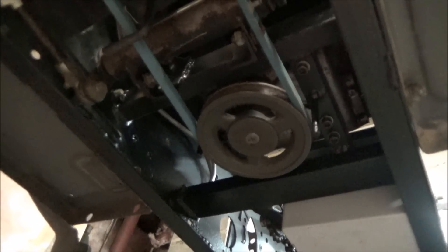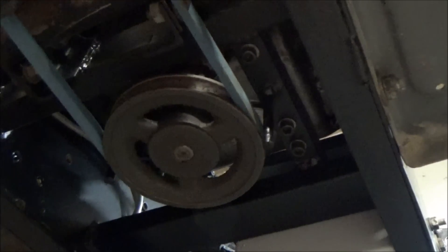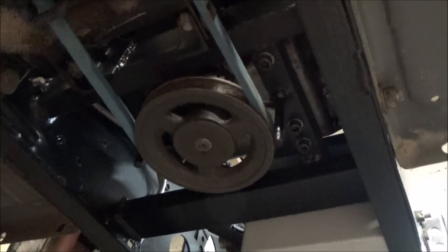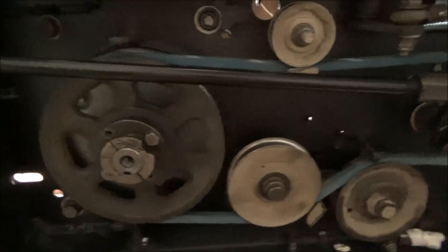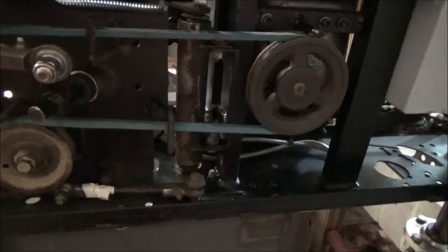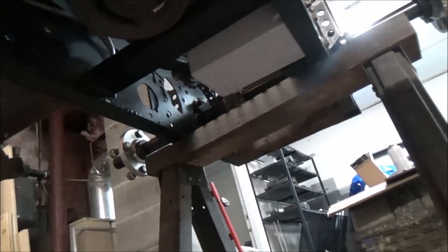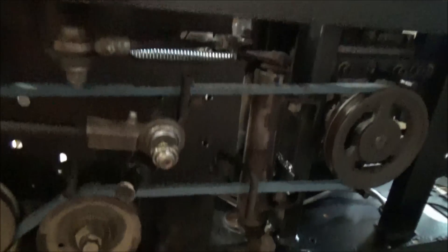Underneath the transmission now, and you can see the rear pulley. That's the transmission up there — it's a little grimy but you can see that aluminum. It's bolted into just a little bracket I made up. There's the battery down there for reference. You'll see it's not all that much different from a regular stock lawnmower — it's still a belt drive. That's in the rules. I race USLMRA, and I believe it's in most rules to have some kind of belt clutch where you actually have to disengage the belt, except for some of the more exotic race classes. The steering arm down here — this is all custom-made stuff. The clutch I made up myself, so we really don't use that many stock parts on these mowers.